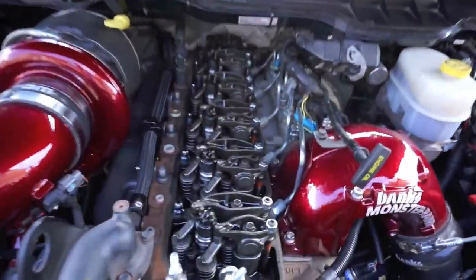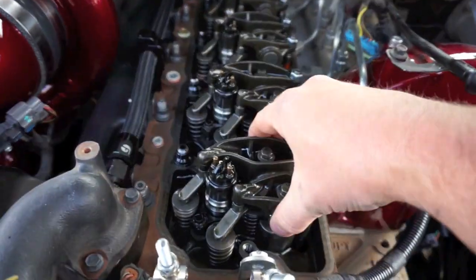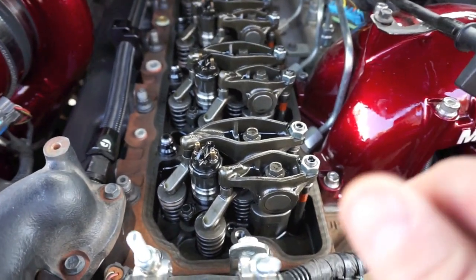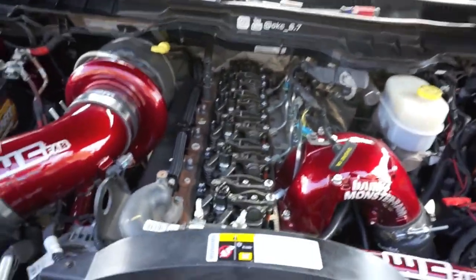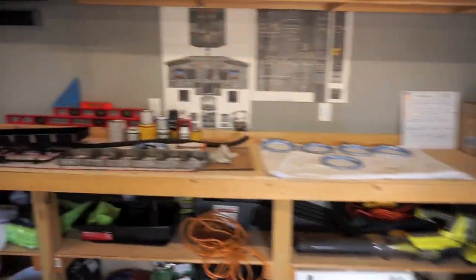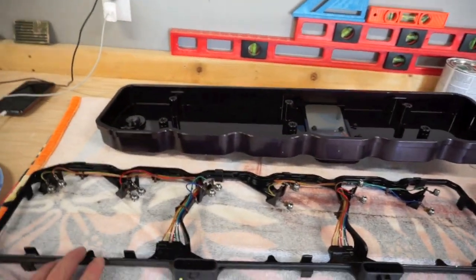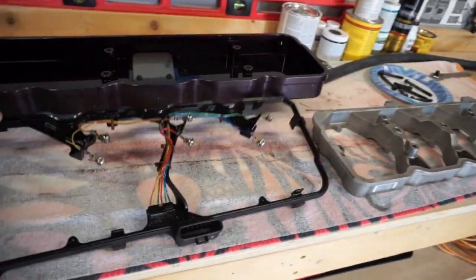Pretty much we've removed the valve cover, the rocker arm, and the harness. I've already undid the bolts so I'm just going to pull these off the rockers, and then we're going to get to re-torquing all these head studs — going to re-torque them down to 150 foot-pounds. I like laying everything out so you can see it. There's the valve cover upside down, and next comes this wire harness. Make sure you unplug it right here and right here — it actually sits on the motor like so.